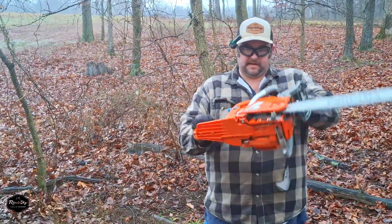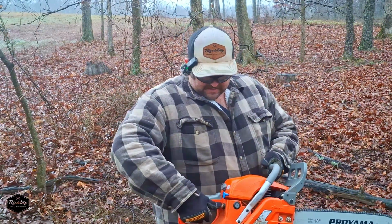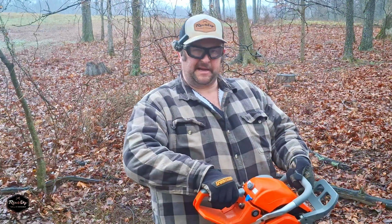Okay, everyone's favorite chainsaw. Primer bulb's empty. Get this thing pumped up, get it started. I'm gonna start out with taking the L-jet out about a quarter turn and see where that gets us. We may end up taking some more.